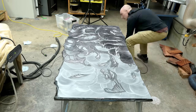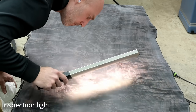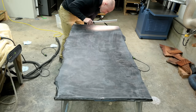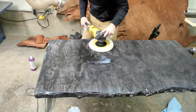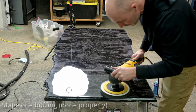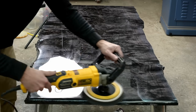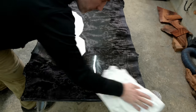I did go back down to 800 grit, but this time I did what I should have done the first time — got the inspection light out and really, really combed over it between grits. This is what you need to do to make sure you don't have problems like skipping grits and having to redo the whole thing again. I'll show you what it looks like after stage one — that's a nice shine, but we can get it even shinier. I'm using the 3M Perfect-It kit — a really cool kit that buffs out really well even for guys who don't know what they're doing.